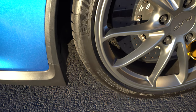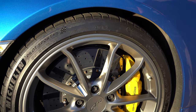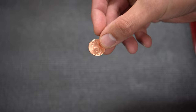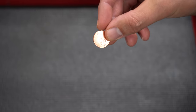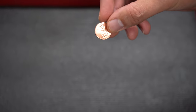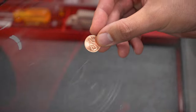A lot of people don't know that if there's any damage to the outside of the tire itself, it's not repairable — it has to be replaced. Let's show you the penny test to check tire tread. You need to use Lincoln's head, put it with his head facing the tire, and you want to see the tire cover up most of his head. At minimum, it should cover his forehead.